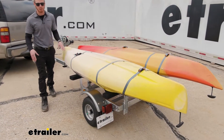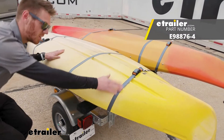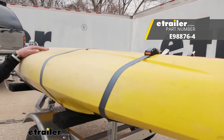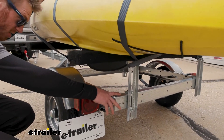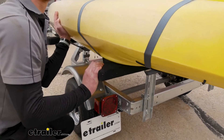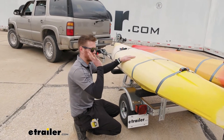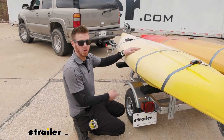If you're using the winch, we're going to need to strap the boat down. It does not come with straps, so I'm just using the eTrailer kayak straps. I like them — they work really well and they have little protectors for the bottom of our boat. What I'm using is the bunk brackets to kind of wrap it around and get it nice and tight. As you can see, this thing isn't really going to go anywhere. More straps the better in my opinion, so I usually load it up with straps. Make sure you grab some whenever you grab the trailer.